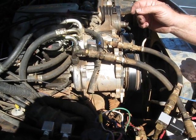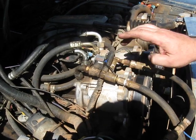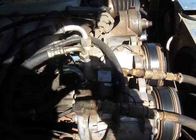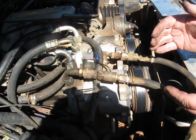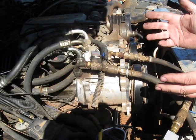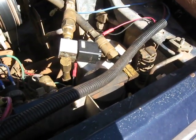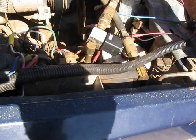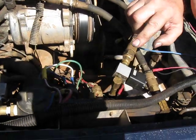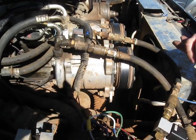The way to get that to work: here's the vent right here. When this compressor starts up, this valve right here opens and relieves the pressure on the crankcase — it works just like the crankcase ventilation on an engine. You have to ventilate it, otherwise the oil will start getting forced past the rings. By keeping the pressure out of the crankcase, any oil that would escape the rings is pushed back into the crankcase. There's a little bit that does get by, and that is collected here in this oil separator. When it comes time to recycle the oil — otherwise we would eventually lose all of our oil — this vent will close and I'll hit the button on the purge valve. While the system is under pressure, this valve opens and puts all the oil back through this line and into the crankcase.